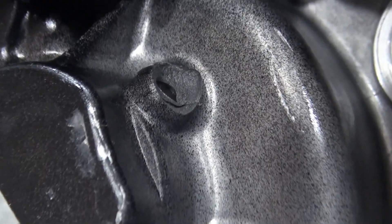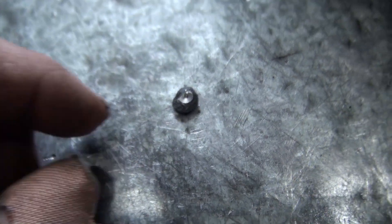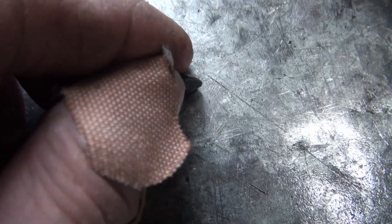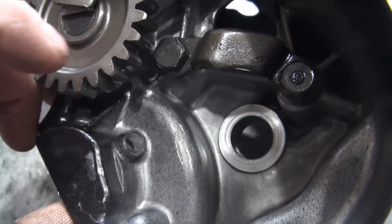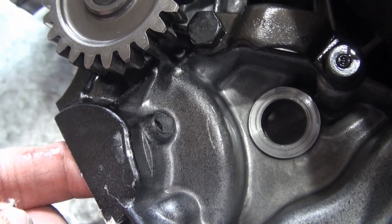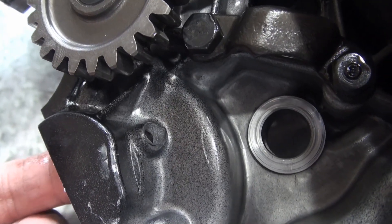You can see how it actually looks like a piece has broken out of there where the other side of that pin is. As I was turning the case over, this piece fell out — I think this used to be there and broke off. Could it be that from the factory they tapped it in too far and broke that piece off? If so, this engine may have had the first gear problem for a long time, or maybe it took a long time for the bearing to slowly migrate and begin causing the issue.